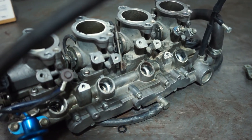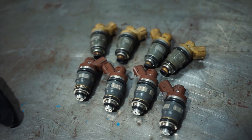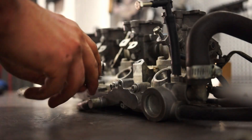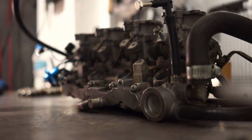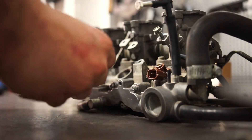What do you need to do when you are upgrading your fuel system with your tune? Mostly it is just the injectors that need to be put into the tune to actually get the car started up with the old map you are already have on the ECU. But there are some things you have to look out for that might not be as straightforward as they appear.